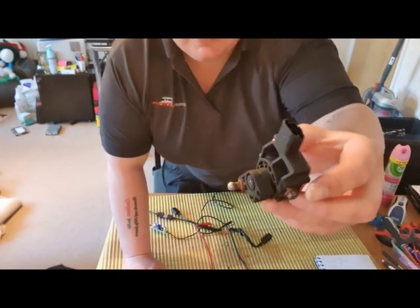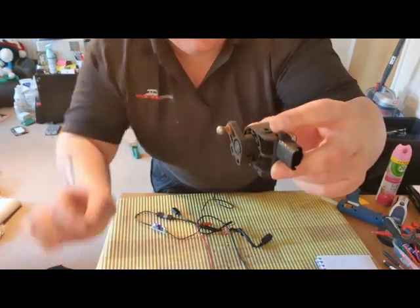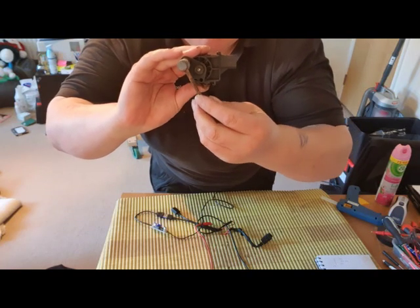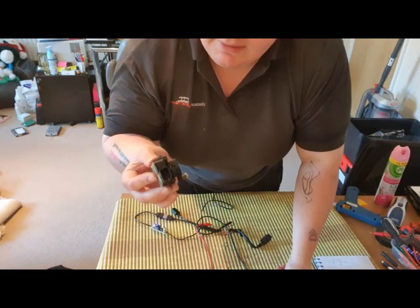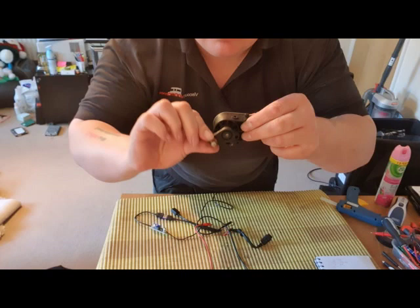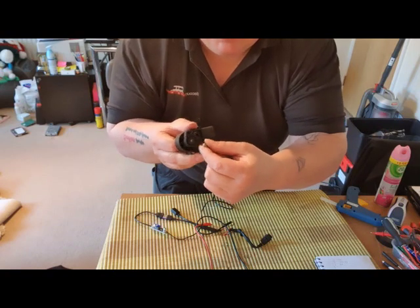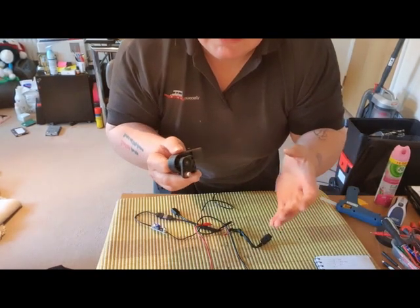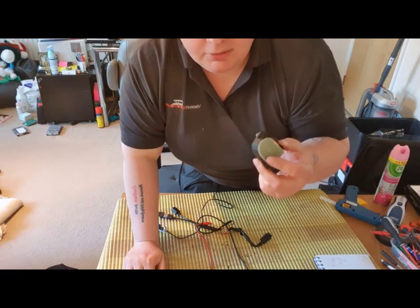This outer casing is clipped in with a little bolt underneath, and the other arm — basically there's a small linkage that clips onto the sensor, and then the other end clicks onto the anti-roll bar for the front or rear. The sensor for the front is identical to the sensor at the back. So as the car is going up and down, it also moves this up and down as well. No matter how hard or how many times you turn this around, it doesn't stop — there's no resistance in this thing at all. I've had a quick look in the back, and there's actually a small microprocessor in there with a sensor in it.